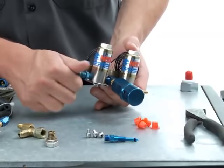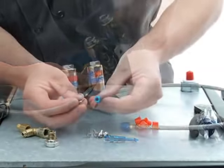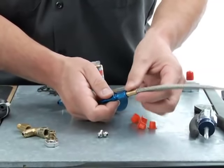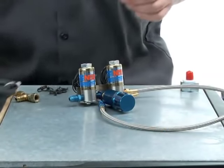Next, screw the nitrous filter into the initial solenoid, then thread in the feed line that travels from the secondary solenoid to the nozzle, along with a tuning jet. Now you'll have a temporary plumbing assembly that will help you determine a number of variable mounting options.